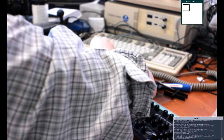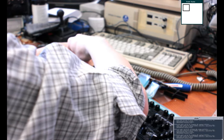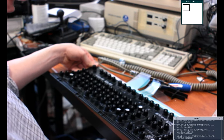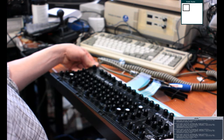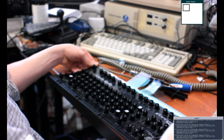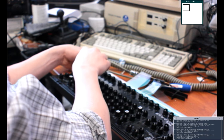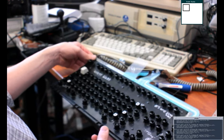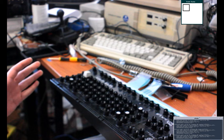Let's start with the escape key. Okay. The control key. Yep. And caps lock, which should also register as control because of my keyboard setup here. And you might find yourself fine-tuning this a lot. That does feel snappier. I can feel it on that key. Didn't really on the others, but I felt it on that key, from the thinner rubber sheet. Yeah, I think this is working. I mean, I won't know until I have it all back together. But I think I can probably end it here, honestly.